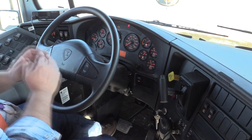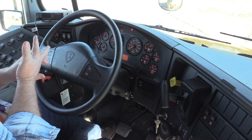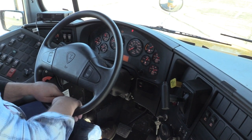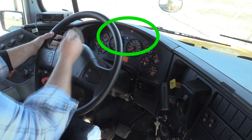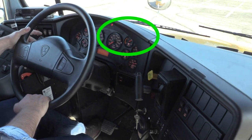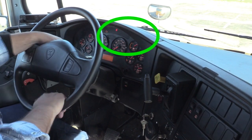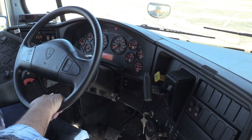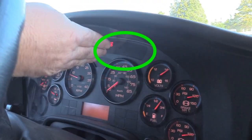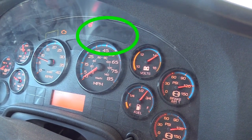Now I'm going to check all my lights. To do this properly, I would either need to get out of the bus or ask someone for help. I'm going to check my strobe lights, my clearance lights, my backup lights, my brake lights, my license plate lights, and my running lights. I'll also check my headlights on high and low beam and the indicator in the dash. I'm going to check my left turn signal and indicator, my right turn signal and indicator, my four-way hazards and indicators. I'm going to check my student flashers and the amber indicator in the dash. I'll check my warning lights and make sure the amber indicator has switched to red.